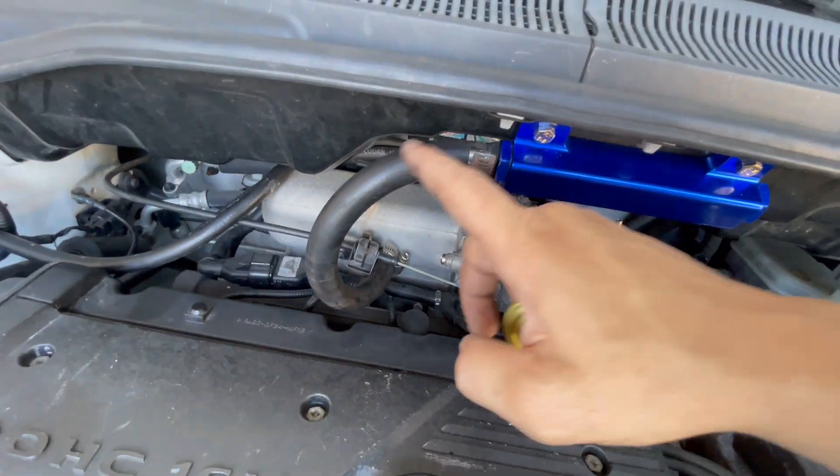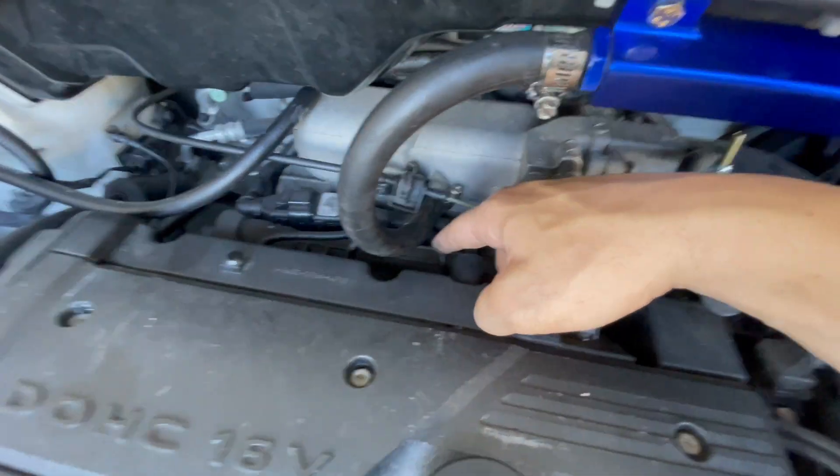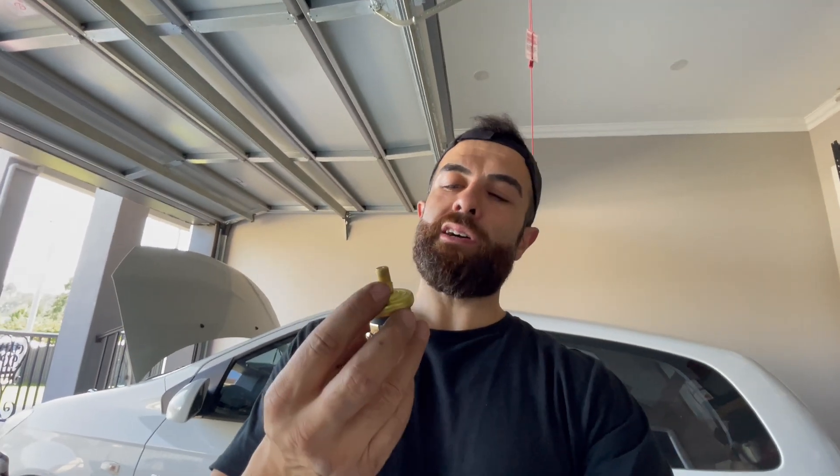Now that the block is on, I've decided to use a nice big hose so that if you need to get to the injectors, it's a lot easier to yank out. The first thing I want to attach is a vacuum pressure switch. This thing activates at one PSI — it's a normally closed circuit, so when you see one PSI you open the circuit. You can use that on a five-pin relay to activate something. It's in case I need to play around with the oxygen sensors, forcing an open loop or getting out of closed loop. I can also put a nice light on the dash that turns on each time we hit one PSI or more.